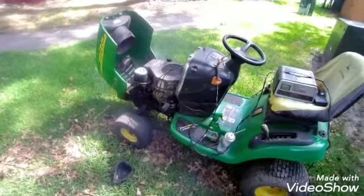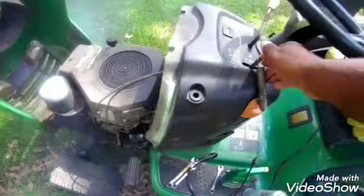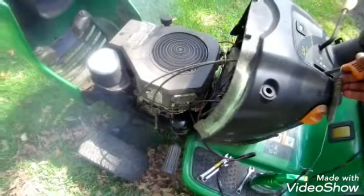I eventually had to go get the battery charger because I killed the battery. Right now I've got it running because I had to end up taking the bowl off and doing a quick and dirty — just shooting some brake cleaner all up around the needle and seat. Cleaned out the bowl. The bowl did have some debris in it, which is strange. I haven't used it since April, it's just been sitting, but the bowl had debris in it. I thought for a minute it was the fuel solenoid, but I had already cut that off. Once I did the quick and dirty and put the charger on her, she fired up. I wished it had sound so you could hear how nice she runs at idle.